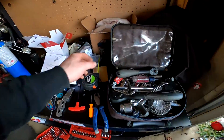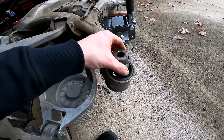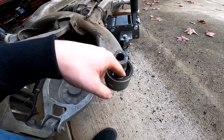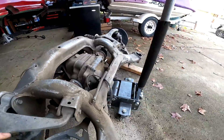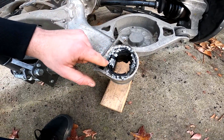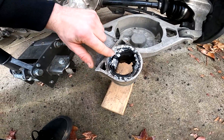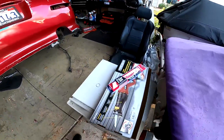So let's get into the video. Before I started, I was trying to air chisel these out. I drilled out two of the centers — here they are. I basically just drilled out the rubber around them, and now all I gotta do is get these sleeves out. I need to drill these front ones out. I tried air chiseling them but it just started mauling the sides. It has a chamfer on the top side so it'll be okay, but I might have to file that back down. The air chisel wasn't working.